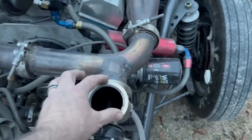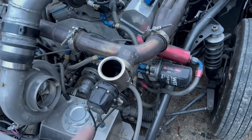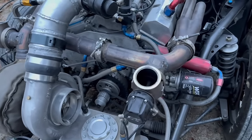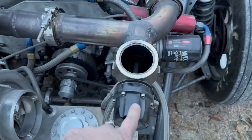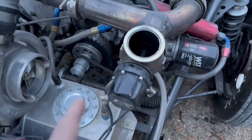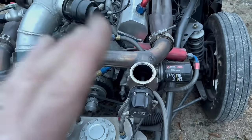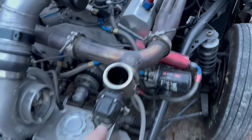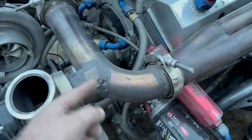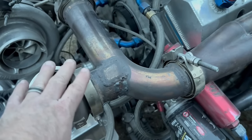You have to be careful about bends or restrictions in the vent pipe — if it's too restrictive or too small, the wastegates may not flow enough. For me, bigger is better. I have really light, roughly two-pound springs in these gates. Ideally I'd want the wastegate to open at two pounds or even zero pounds. Priority flow matters too — if the wastegate is positioned in the direct flow path of exhaust gases coming around the bend, it dumps more effectively when it opens.